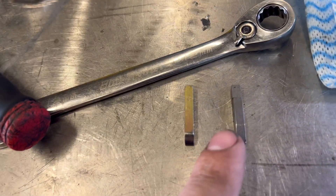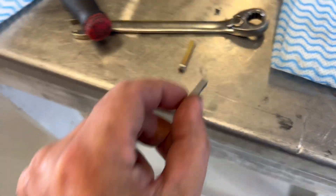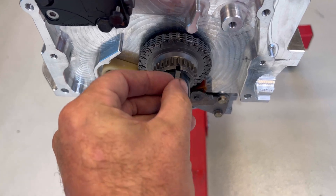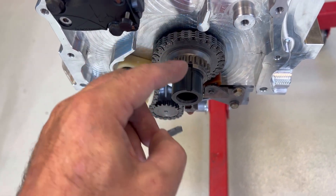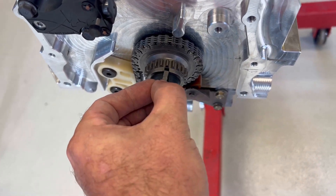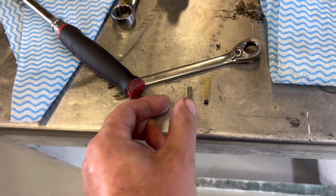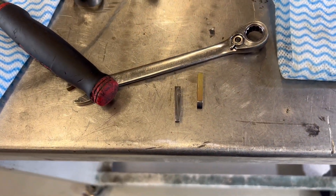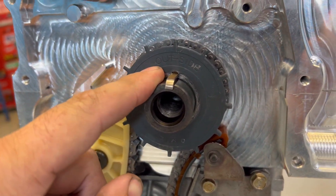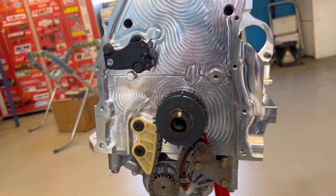Something we keep having an issue with — these keyways for some reason are the Drag Cartel ones that have the crank machined to take that as well. It's down to the back of the crank and also to the crankshaft via this keyway. For some reason we keep being able to twist that — don't know what's going on there. The balance is always tight, so something's moving. And don't let the trigger wheel catch us out — you see it on all the Facebook pages: make sure that's facing the outside of the engine.